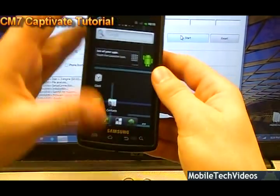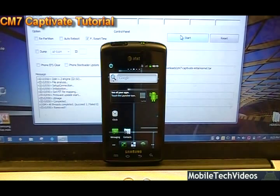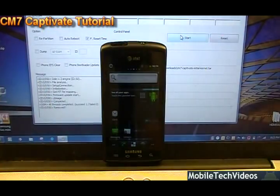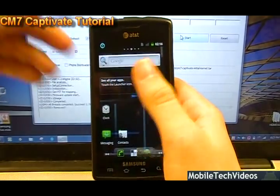It's not that tricky — you just have to do it all correctly. I'll save the rest for a ROM review, but that's how to flash CyanogenMod 7 on your Samsung Captivate. One more recap: started from stock JF6, flashed SpeedMod kernel with Odin 1.7, booted into download mode, flashed SpeedMod kernel. After that, did a three-button combo to reboot into recovery, installed EFS Backup zip, rebooted into download mode, flashed the CyanogenMod kernel, rebooted into recovery again, flashed the actual ROM, wiped Dalvik cache, system reset, wiped the other cache, and rebooted — nice Gingerbread.